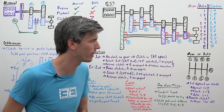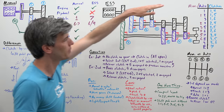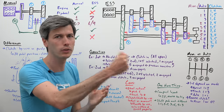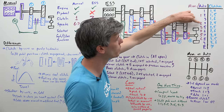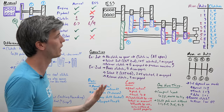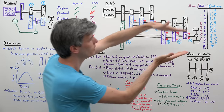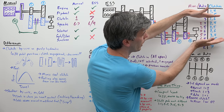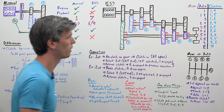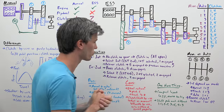There are some disadvantages. When picking six gears out of nine, some ratio steps could be too extreme — for example, going from second to fourth might be too much of a drop in normal mode. For track mode it's less of a problem since you're selecting three through eight with tighter steps, but it could mean ratios aren't perfectly matched for manual driving.